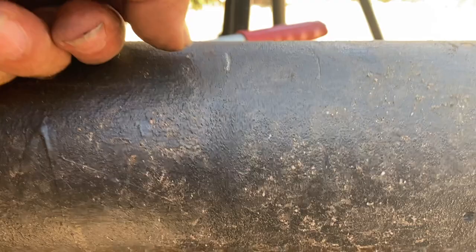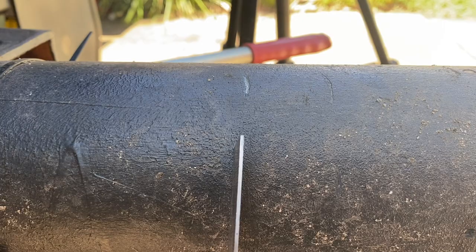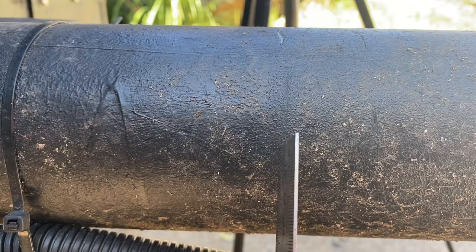Now the actual cut of the drawbar, we'll do at welding Stig's workshop because I have to tow the camper up there. However, I've been advised it would be good if I could drill out the plug weld holes, which are 100 mils either side of this cut, and they're to be a 12 millimeter hole. So we'll drill those out now, and those holes will be at the side and just go straight through with the drill.